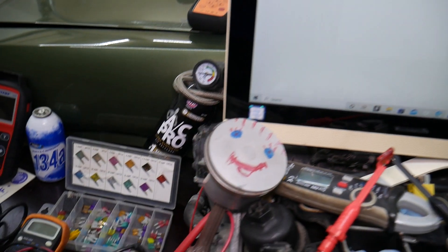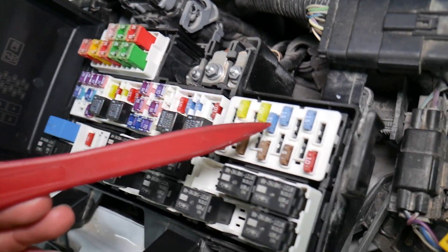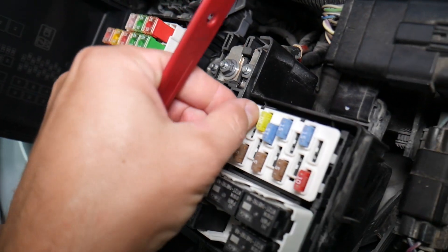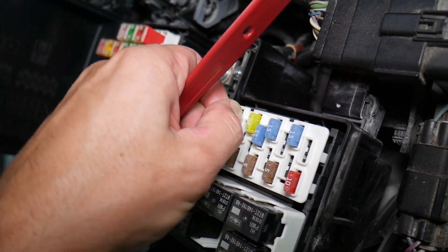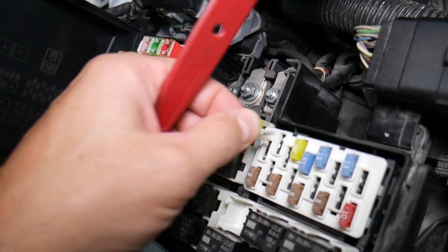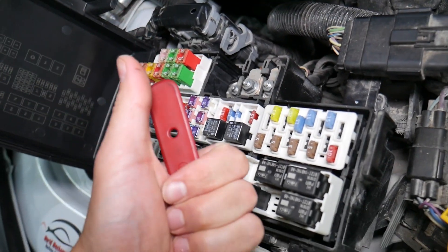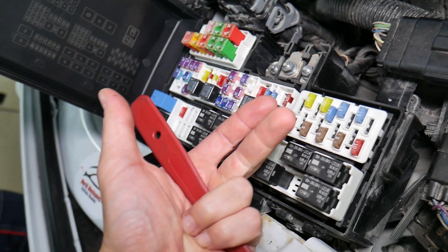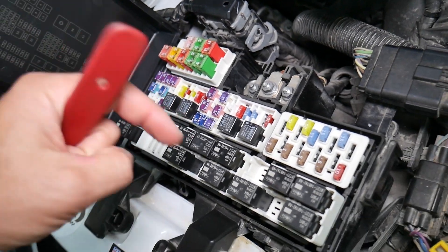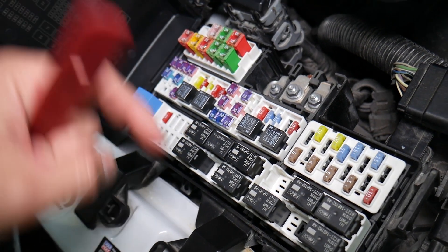Before we continue, let's explain why it's important to always test fuses and relays. On those fuses, you cannot clearly see if they're burnt or not — especially with JKs fuses. If you remove a fuse, look at it and assume it's a good fuse, but it's actually a bad fuse — sometimes you cannot clearly see that. At that point you can put the bad fuse back in and start replacing parts that you don't need to, losing your time and money to fix a problem that doesn't exist. All you have to do is test the fuse and replace it. We'll put a link to a special video that will teach you how to test fuses and check relays easily. Check it out — it will be in the description of the video below.